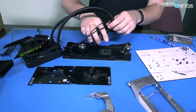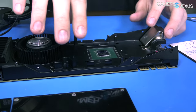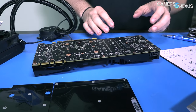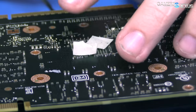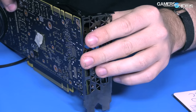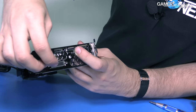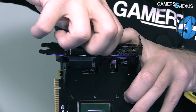We're going to ignore that plate and build this ghetto style, which is fine because we don't need it to look pretty — we just need it to run for overclocking tests. First we have to rebuild this card, starting with screwing in from the underside all the pieces I removed earlier. After reapplying thermal pads where they belong on the backside of the GPU, the first thing to do is reinstall the expansion cover. There are a couple of screws for this, plus hex bolts flanking the DVI slot.